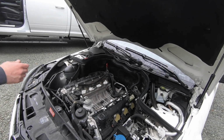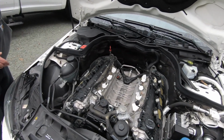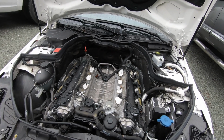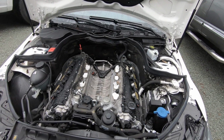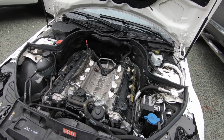The motor looks so much bigger like that. I know, it's a wide engine. So I pulled the intake off and just vacuumed everything out. Got to clean around the ports a bit. Shove some paper towel in so we don't get any dirt inside the motor. Sweet.